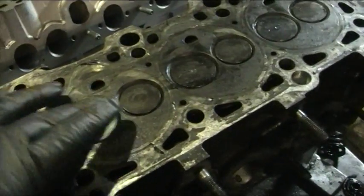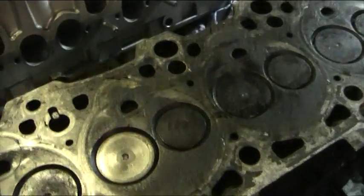And there was no reading on that. That means that this valve is leaking past excessively.